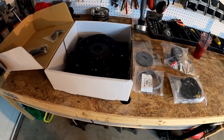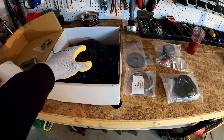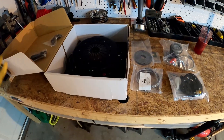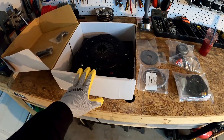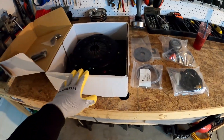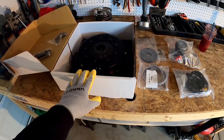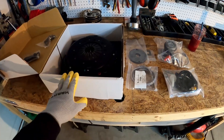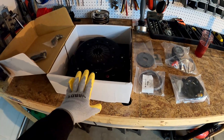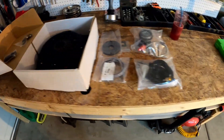I want to use this clutch with the 6-liter, which is going to make more horsepower and will require me to go to the dyno. For that, the clutch has to already be broken in when I drop the engine in, because the car presumably won't drive like it should. I only want to go to the dyno and do tuning once, instead of having to do it twice — once for breaking in the clutch and then again for actually making boost and power.